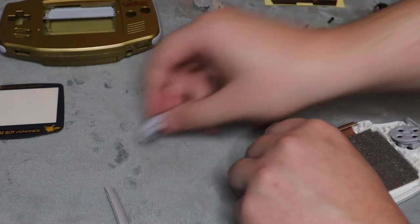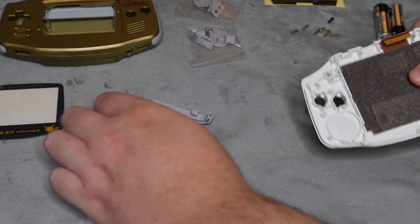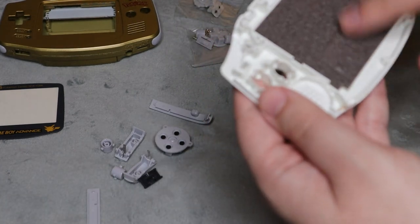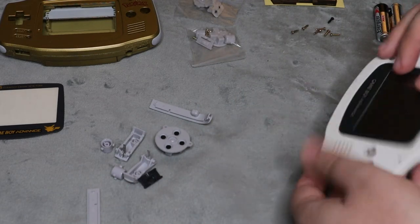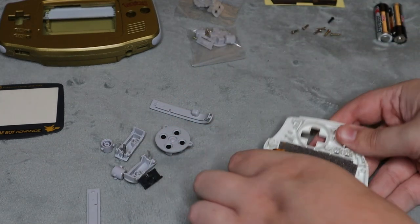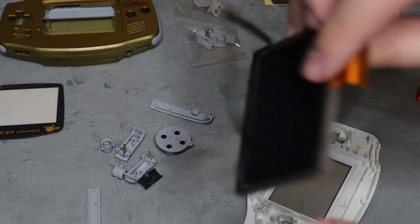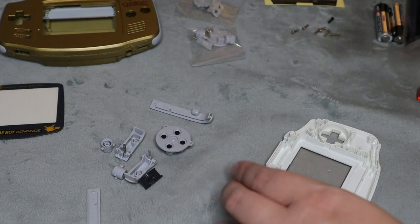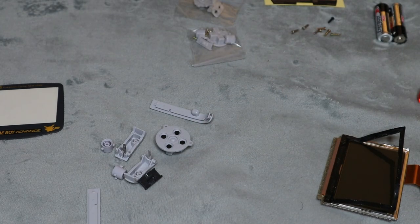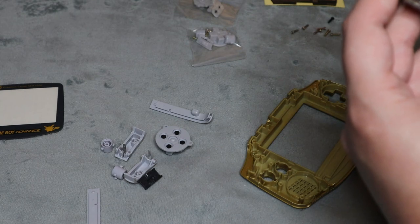Next, what you're going to want to do — I'm just going to take the buttons off here, just because I'm not going to be reusing them, so they're going to be in my way in a minute. Now what you're going to have to do is reuse the screen here. The cover on this side we do have a replacement for, but the actual backlit screen we are going to reuse. So you are just going to push around a little bit, trying to loosen it up — just like that, it is peeling off here, very slowly. And this black strip right here, we're going to be using on the replacement shell, because that usually you don't get a replacement for.